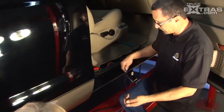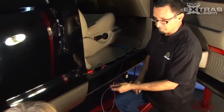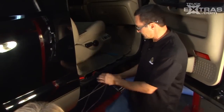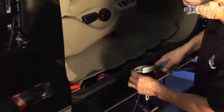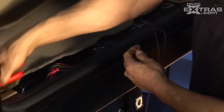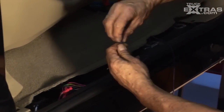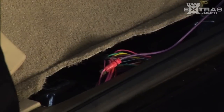On this particular model, it's got two purple wires with black stripes, so it doesn't matter which wire you grab — one is designed for the back door and one for the front door, and on this application you don't care which is which. I'm going to measure up to about right there, then go ahead and cut it since it comes with the wires really long — plenty of wire. Then I get my crimpers and put those right there, loosen this up, put this cap through right here, and tighten it up. It tightens the wire in there and we're done with that right there.